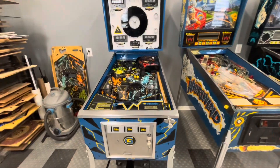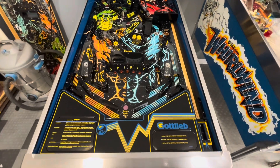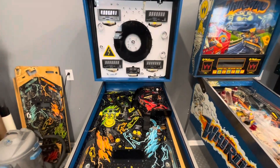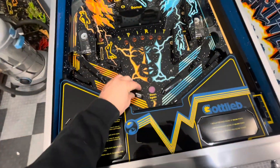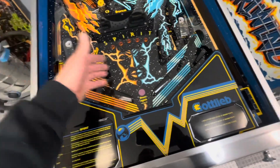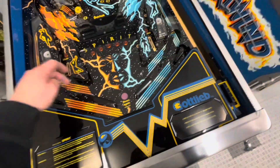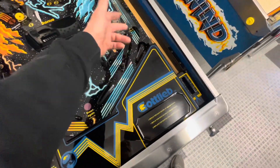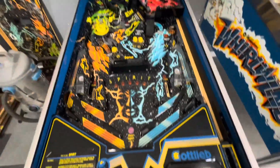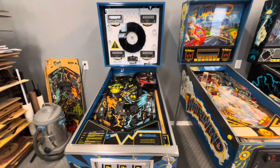We're looking good. We got flipper rubber waiting on that to show up today. We'll finish putting that back glass together and put it in place and set the flippers — I'm just not setting the flippers quite yet, because I really want the rubber on there. A game like this, I can promise you you're going to have flipper hop all over the place — that's just what they do. They've got wire guides leading to the flippers and a gate it's going to be riding on before it gets to the wire guide, so it's going to be kind of bouncy. You can't redesign the thing, but try to get it to a minimum.